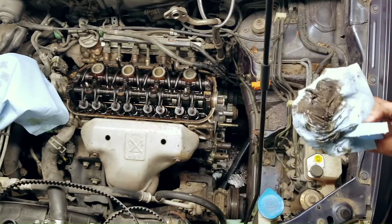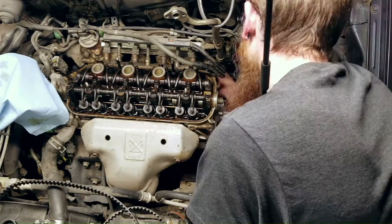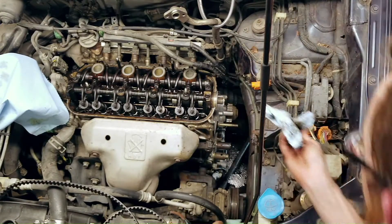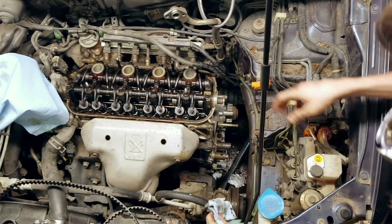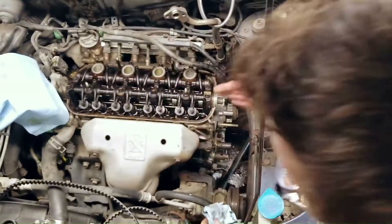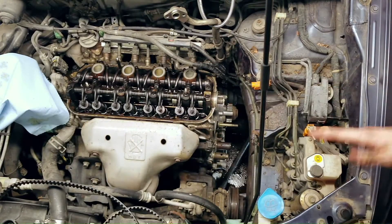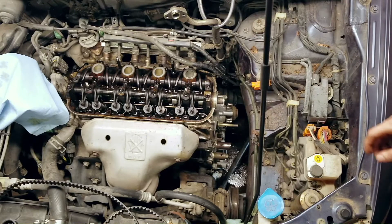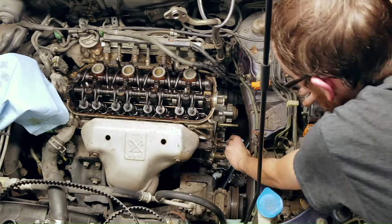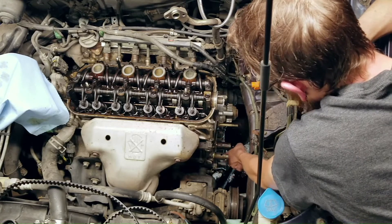Something tells me this whole engine is dirty and that's bad. The valve cover gasket was completely pinched - blown out on two parts on the back side and pinched against the head - so it was not holding in oil in a couple of places. It doesn't work very well when it can't keep the oil in.